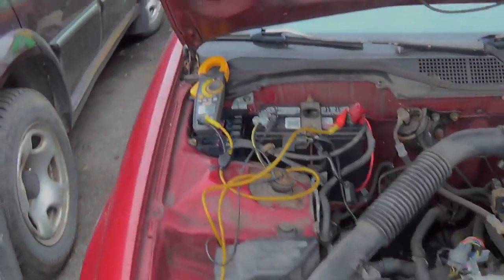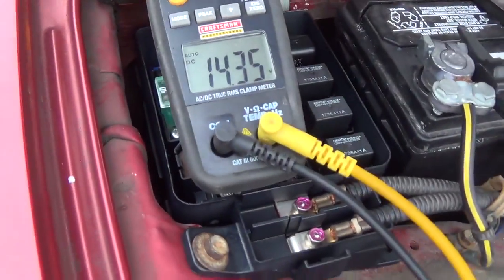Turn the engine off, key on - there's our battery light. Let's get a meter on the battery. Now the question remains: what blew the fuse? Keep in mind they replaced the alternator and the fuse box with the ELD unit - either of those things could have blown the fuse. We can wiggle some harnesses, but since the parts they replaced could have caused it, it's not worth spending hours on it if the problem isn't even there anymore.